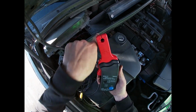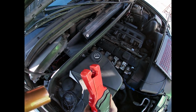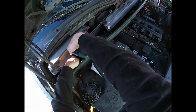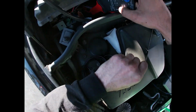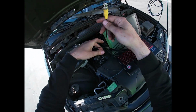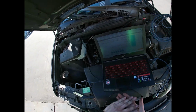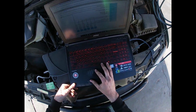Arrow going backwards on this. It's hard to see, but there's an arrow right there. That's current flow on the meter, on the probe. So I like to go around the wire, and it's not activated. Turn it on. It's calibrating itself on the turn on usually, like the high amp probe. But I like to connect everything and then just hit 0, and I'll double check the 0.